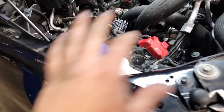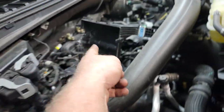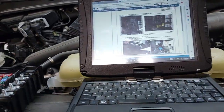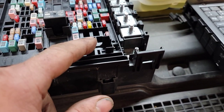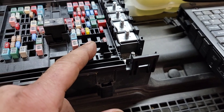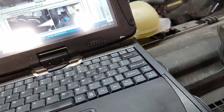Now let's put it all back together. Tape your base and stuff up. Put your zip ties around where you cut them to get it out of the box. Before I start putting everything back together, I went to the next step and it says to remove the relay and fuse from the BJB. It says remove relay and 25 amp fuse from BJB identified in figure 52. That relay and that 25 amp fuse are there.